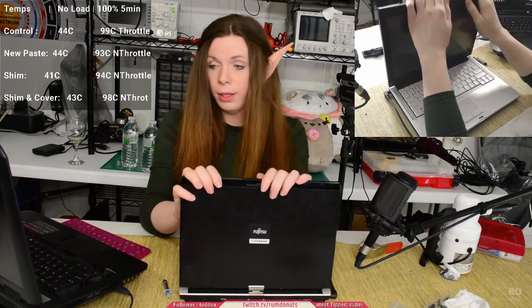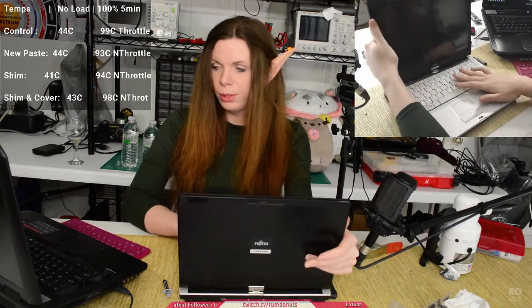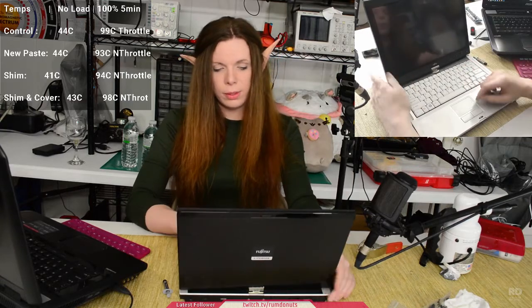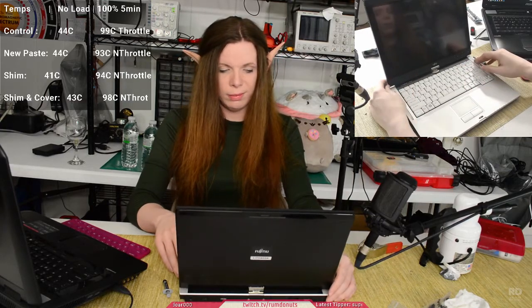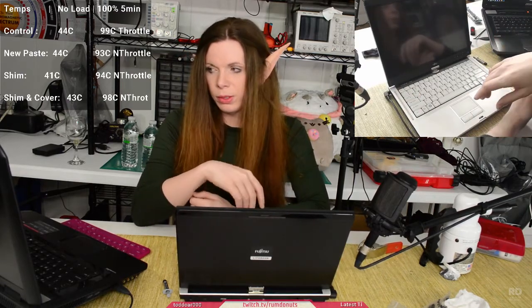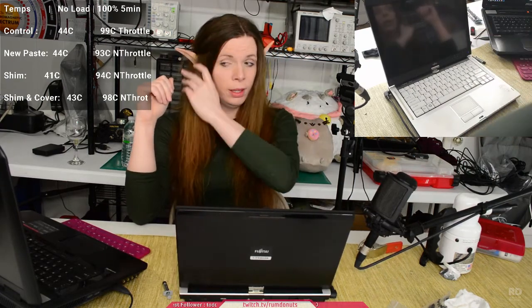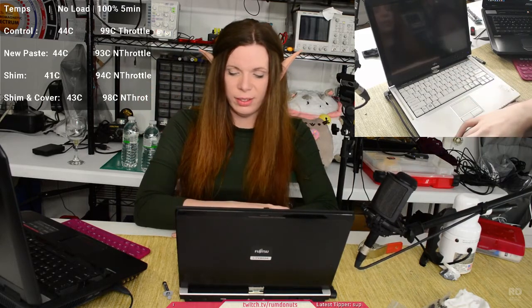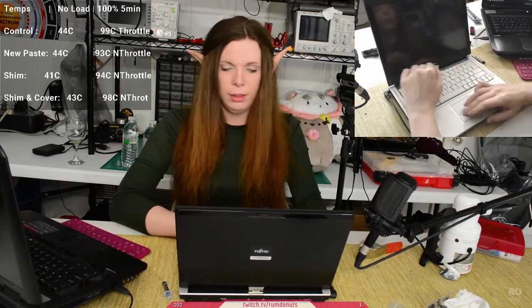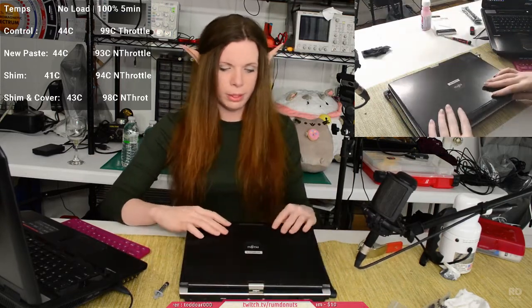One thing I'm not going to go into today that I want to at some point is undervolting, where you feed your chip the lowest amount of voltage that you can to get the TDP down. Because the chip doesn't have to operate necessarily at the voltage that it's at. It can actually operate at a few millivolts lower, and you'll get less thermal dissipation. And that's actually one of the most effective and cheapest ways to reduce your laptop's heat. But it's a lot of finagling and a lot of software. You've got to test it, see if it crashes, then bring it down point by point. Test it for stability. It'd be a really boring episode, I think. Episode, stream, whatever.